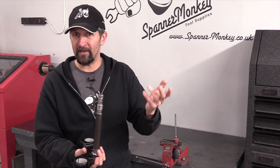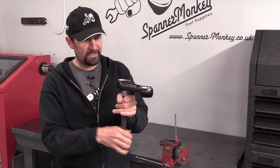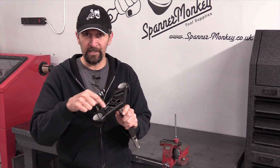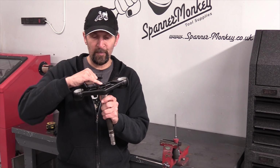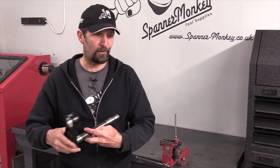So in the usual way I've done in the past, turn them upside down, put the bearing on the jaws of the vise and tap that down in, but I'm still hitting on the bottom of it. So rather than hitting on it and risking chipping the new paint, I'm gonna make a little drift to go inside the stem and it just bears on that protruding steel lip and nothing else. Need a tool? Make a tool, like they say.